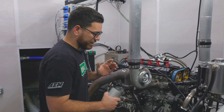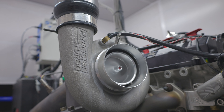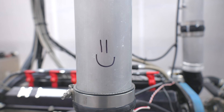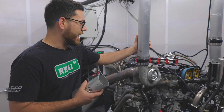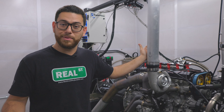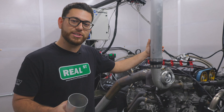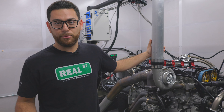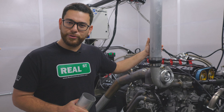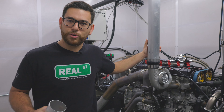For today's video, we have a Toyota 2JZ mounted on here. You might have seen this exact setup before when we did the 6870 comparison video. The only change now is that we have the Precision 6670 turbocharger and the boost is being controlled through these two tial wastegates. We're going to be doing gradually larger holes throughout each run, starting around an eighth of an inch and hopefully going all the way up to about an inch. I think we're going to see a big change somewhere around half an inch, but let us know in the comments what your guess will be. Obviously, it's going to make less power at some point, or we might see the turbocharger speed start to increase dramatically to try to keep that exact same boost target of 15 PSI. Without further ado, let's go ahead and do a baseline run at 15 PSI, see what this engine makes, see what the turbo shaft speed is like, and see what we start working with.